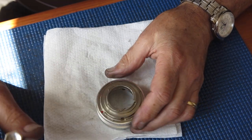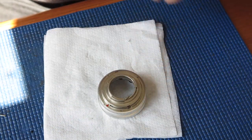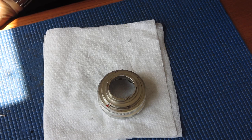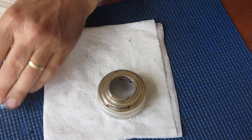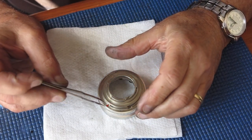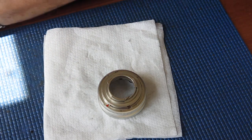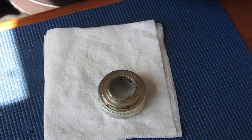From the rear of the lens, we have four screws. One of them is locked in place with lacquer — just a red dot — and it's just to help you line up the lens when you're refitting it to the camera. I'll put a dot of acetone on there to soften that, what looks like red paint to me, and remove those four screws.